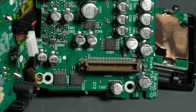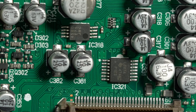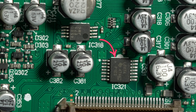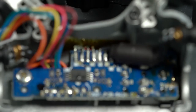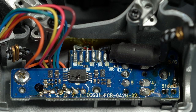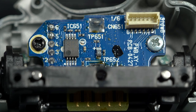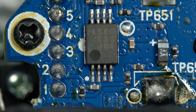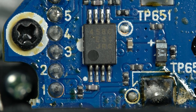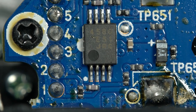Since this pretty much just follows the application recommendations from the data sheets for all the different ICs, it's not an impossible quest. Before we move on, this board also has yet another audio op amp — the NJM 4580 — as well as another piece of 74-series logic from TI, which is just a 74HC07 six-channel buffer. Now let's take a look at the microphone module. On the inside, it's kind of funny — the circuit board that attaches to the microphones actually has its markings written in Chinese, whereas the board on the other side that connects to the mount has its markings written in Roman characters with abbreviations that obviously come from English. The board that connects to the mount has another one of those NJM 4580 op amps, which means the 4580 in the unit itself is probably for the two XLR inputs, while this one handles the input from the microphone module.